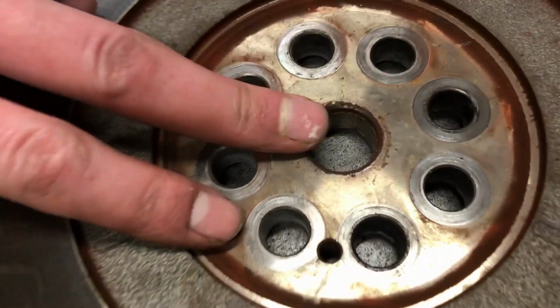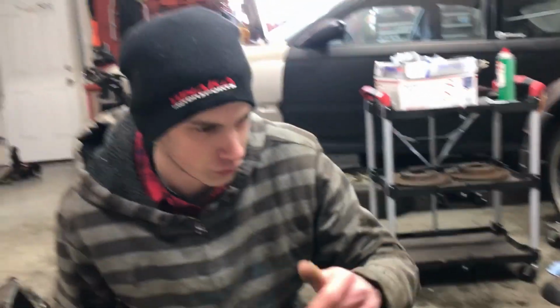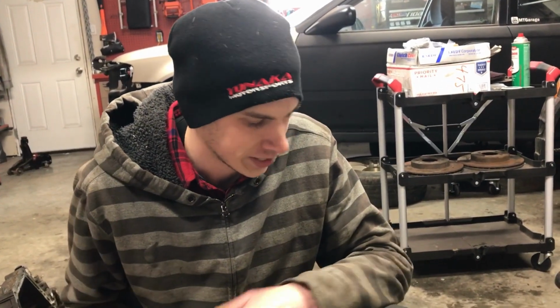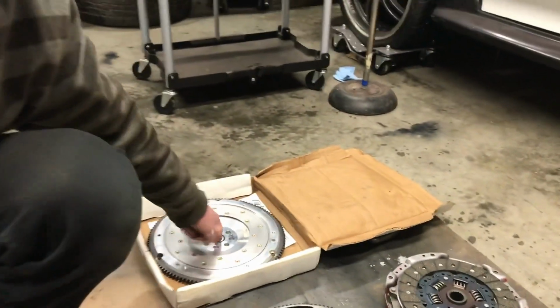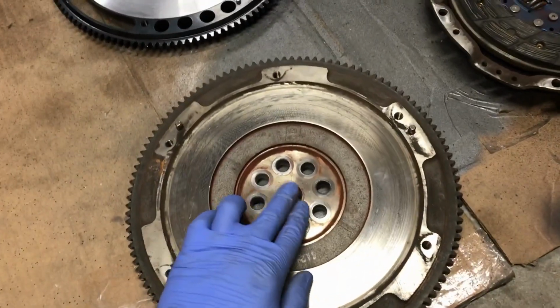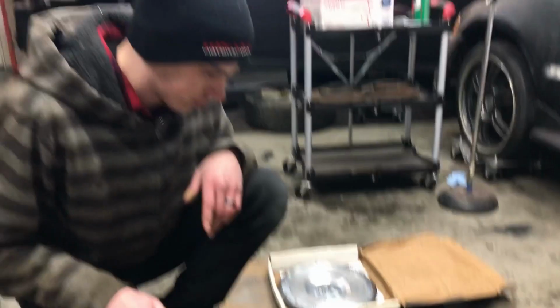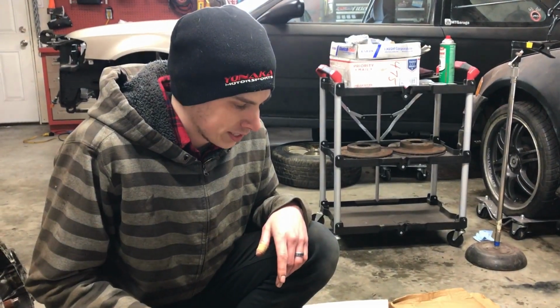So something we noticed on the factory flywheel, I don't know if this is normal or not, but there is no bearing on here. If you guys comment below and let us know if that's something that you've noticed, like this is from a 94 Honda Prelude. Me and Tim, we've never seen anything like that before. I guess it's a factory thing, but both the aftermarkets have a bearing on this guy, a bearing on this guy. We did the Supra, that's an 89. That has a bearing on it. And this diameter is the same as this with bearing. So the input shaft for the transmission fit in there just fine. Weird. It's weird for us, but I guess it's normal.